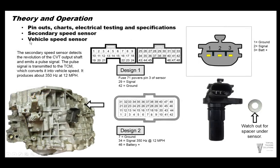The vehicle speed sensor or secondary speed sensor is located on the outside of the transmission on the top. Pay close attention — some of these sensors have a spacer underneath the sensor, so if you're changing the sensor, make sure the R&R technician takes note of whether there's a spacer or not. Testing is similar: you have a ground and battery voltage for this sensor — unlike the primary speed sensor which operates off 5 volts, this one is operated off battery voltage. At 12 miles per hour you should have about 350 Hz.